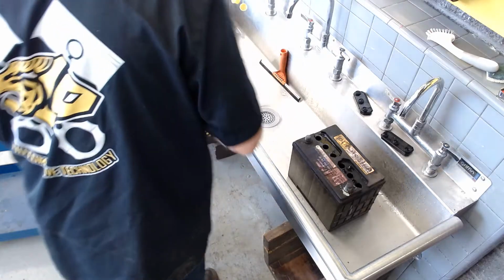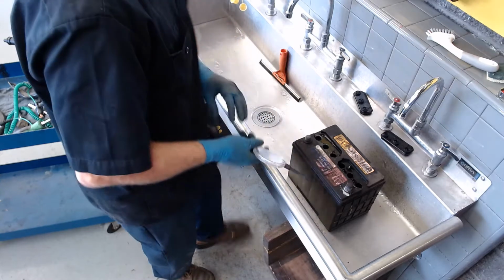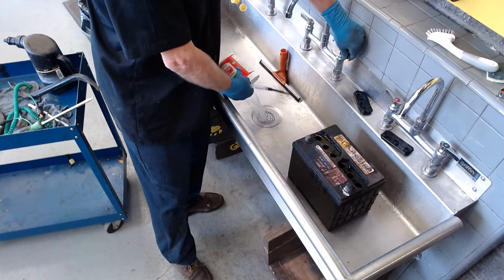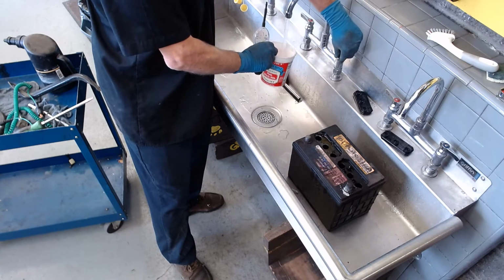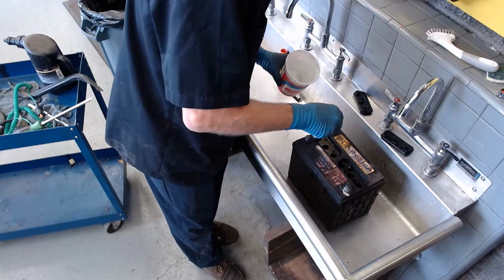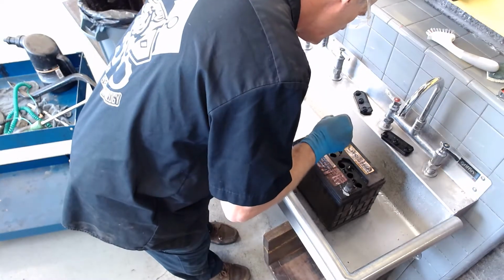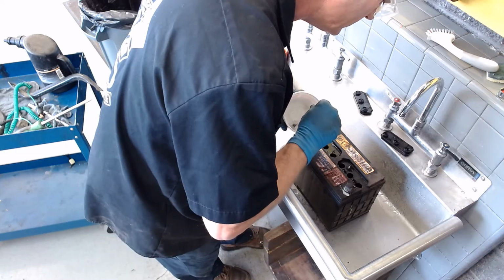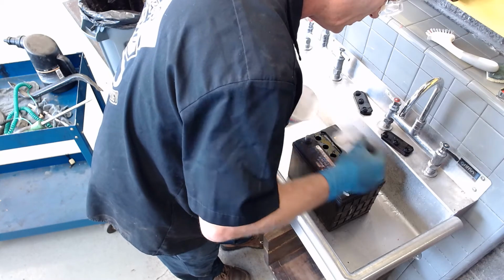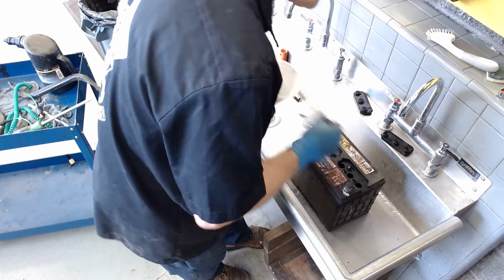I like to take the hydrometer that we'll talk about in just a moment and use it as a turkey basting bulb. I just get some water and suck this up and just use it to push water in there. And so I've got a meniscus on all those. To me, this works a little faster than the pitcher, and the pitcher's fine, but you don't have to have it. You have a turkey basting bulb at home.